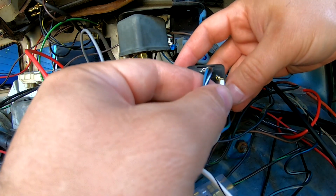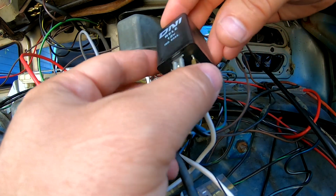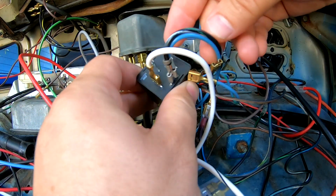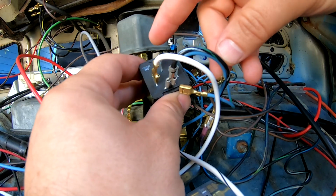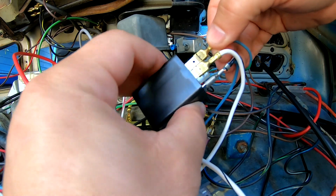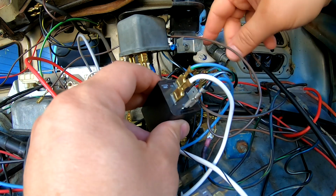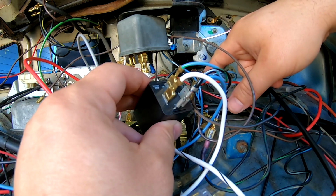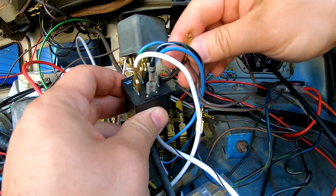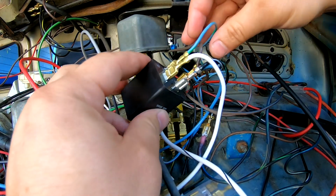And then the blue with green says is on KBL. Oh, there's a K1 and a 31, which I'm pretty sure the 31 is the ground, and then the K1 has to be the KBL, which I assume lights the light right there in the middle for the blinker. And then 31 should be the ground, so plug that in there, and there we go.